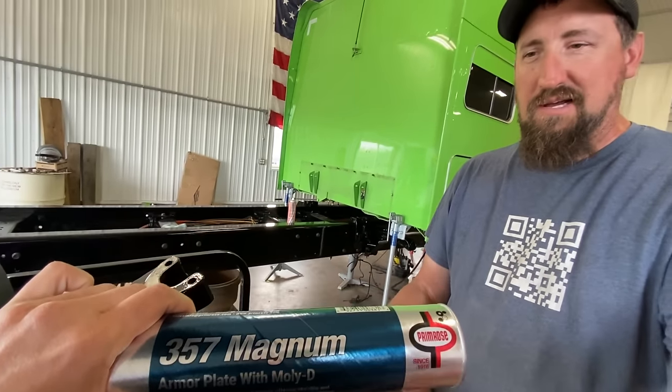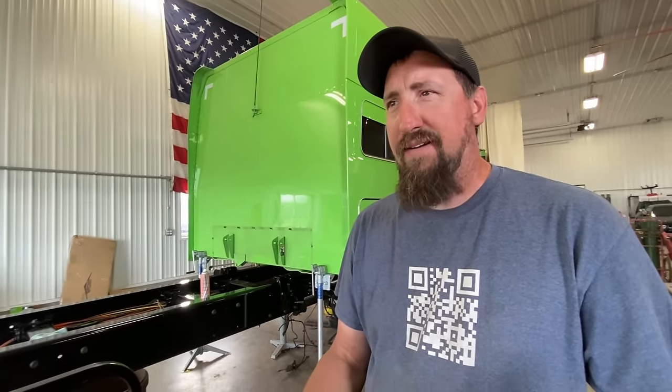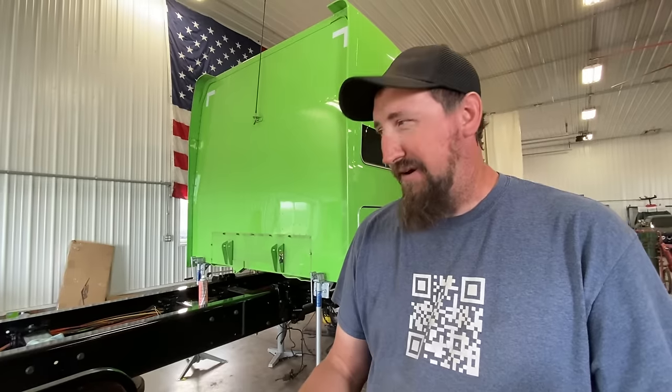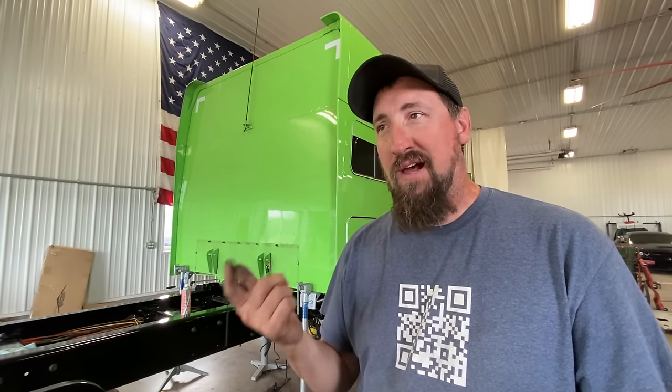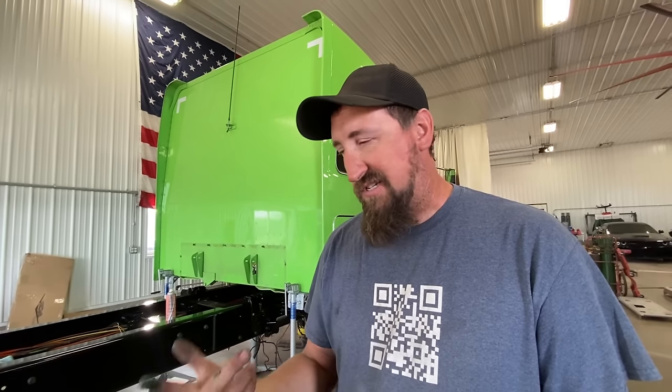But so basically, we had a good testament. Mandy's truck I greased yesterday, day before, something like that, and it was 20,000 miles on a grease. Not to say that you should grease your truck every 20,000 miles, but it just got overlooked. No big deal. But actually, when I greased the U-joints, there was no moisture that came out. That tells me this grease is pretty good grease. Usually you see that brown, milky stuff coming out. That's water. You don't want water to mix with grease. So that tells me in 20,000 miles, there was no water mixing with grease, even at that kind of grease interval. But like I said, use good grease.